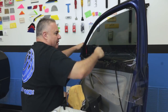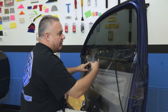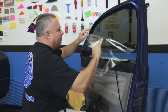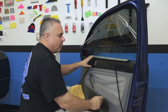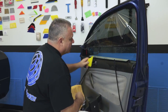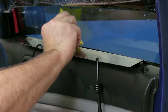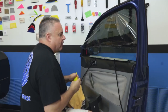I want to roll it up so I can freely move the window with the Gasket Wizard. We can also bottom load with the Gasket Wizard — I may have to do that one as well. I'm a top loader. If we were going to bottom load, we're not seeing a lot of guys using the bungee cords. We're usually seeing guys with handles — usually smaller ones, moving them back and forth. The top loaders are probably going to use a larger one from the kit, taking advantage of what it does, and just cutting the film rather short at the bottom. We don't want to get it too far down in there, but we want to get it below that rub rail.